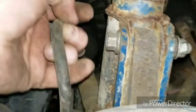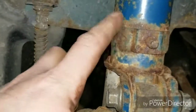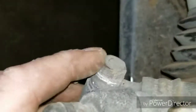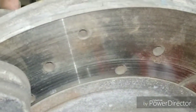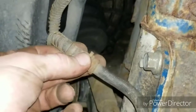The only thing I really have to mess with, other than that, is where I'm going to mount my brake line. I may cut. The big advantage is, especially if going with stock, which I have to look, the AGXs should have a bracket for this. But this is actually already Frankensteined a little bit anyway. There we go. This is, obviously, supposed to be an indexing pin. This is the Mirage brake line. And these are Stealth, I don't know, RT or ES or base or whatever. Basically anything other than the twin turbo all-wheel drive brakes, because they'll let me put a 15 or 16 inch wheel on here, which I may want to use if I'm drag racing.